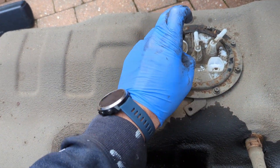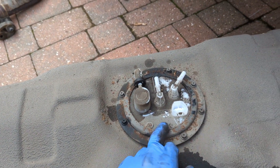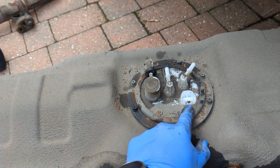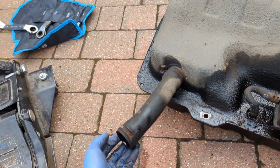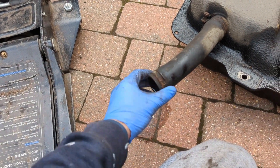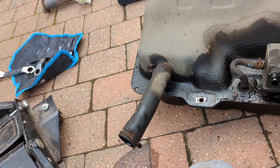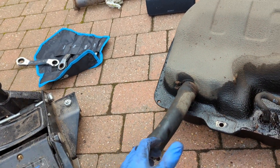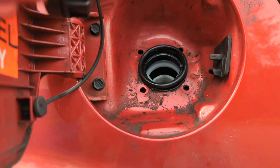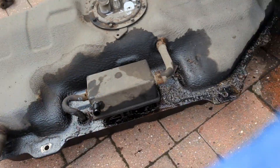There are four connections at the top of the tank that come out with it — those are the two with the orange tabs, plus a plug. For the main fuel feed, it's like a fancy jubilee clip — I think it's 10mm to undo and release it. It's a bit of a fiddle, but you can pull that out. I did release the screws from the top of the fuel filler to try to make it a bit easier, but it didn't really help.